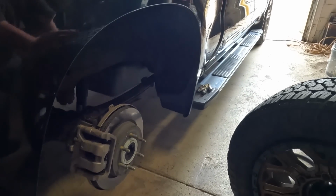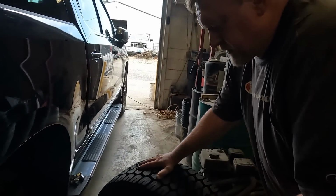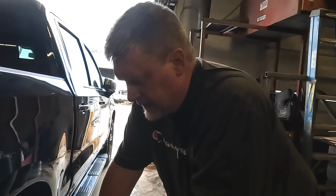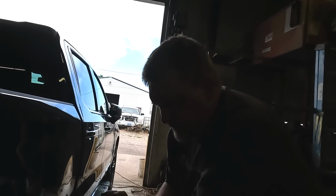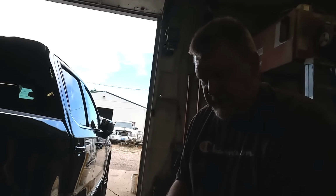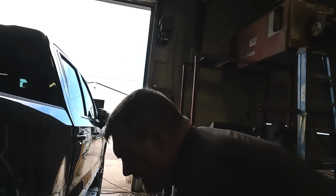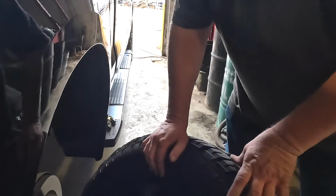So what's the point of that again? It helps center the wheel on the hub of the vehicle before you start tightening down lug nuts. Some people throw the wheel on without the hub centering ring, and they tighten the first lug nut tight with the wrench and then tighten the second one and third one. Well, if that wheel isn't perfectly centered on that hub and you're relying on the taper on the lug nuts to center the wheel, you don't ever want to tighten the first one really tight, because then the wheel doesn't move and doesn't get centered on the hub properly. So that helps, because your aftermarket wheels have this large center bore. Oh, so it goes right in there.